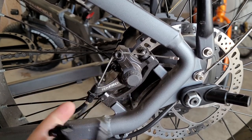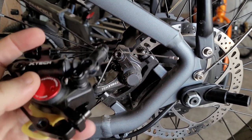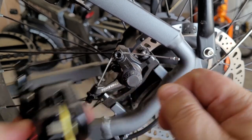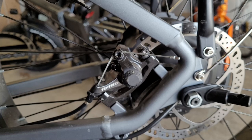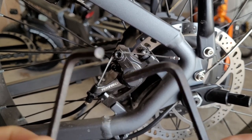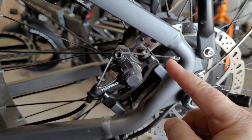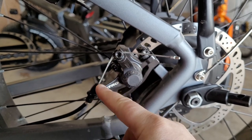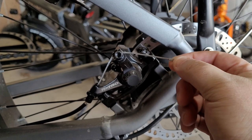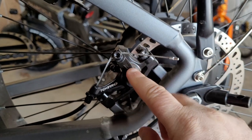We're basically just replacing this part right here, held in by two main bolts. The new caliper will give a bit more stopping power because it uses oil and closes in on both sides right on your disc. It doesn't take a lot — you'll mostly need some allen wrenches and a little snipping tool to take this cap off if we can't feed the cable through. Sometimes it won't go through, so we might have to snip it off. If you don't have any more caps, I'll put a link in the description where you can buy some — you just crimp one on once you install the hydraulic caliper.